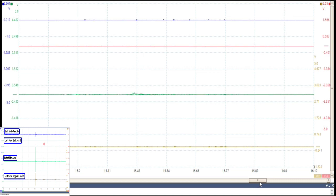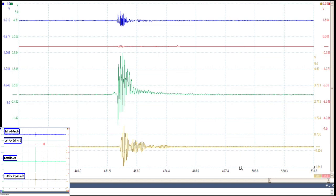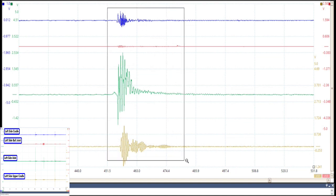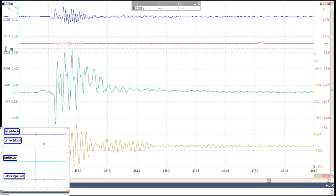On the green channel I'm getting a large kick compared to all the other channels. This indicates we have issues somewhere along the line of the axle — likely coming from the CV joint, the inner cup, or even the transmission. That's showing you how powerful a scope can be for finding noise.